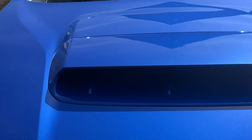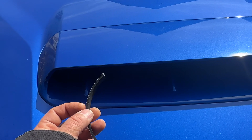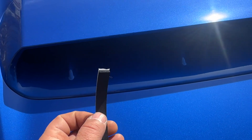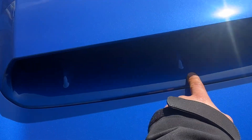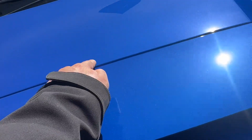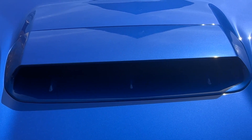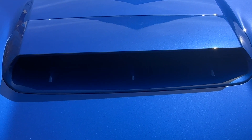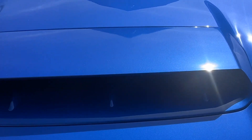Install is relatively simple. They do send you a gasket to run around the outer edge on the inside, but I didn't use it because the material quality wasn't great. Instead, I picked up an eighth-inch by quarter-inch neoprene rubber weather strip and applied it all around the inside of the hood scoop before setting it down. This takes up the space that causes the rattle some people mention. It adds an eighth inch to the perimeter so when you tighten the bolts it sandwiches everything a bit tighter than without it.